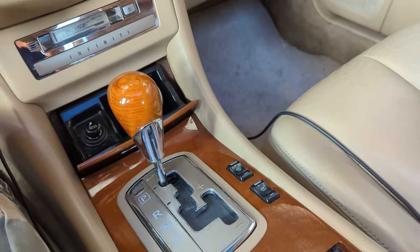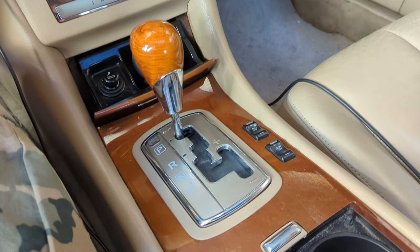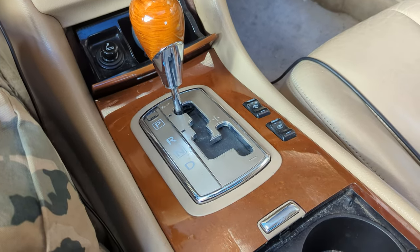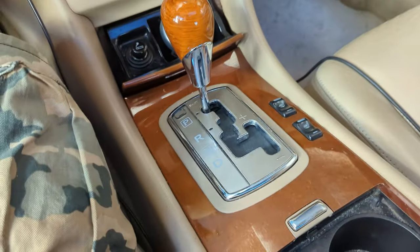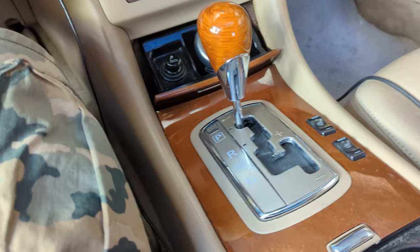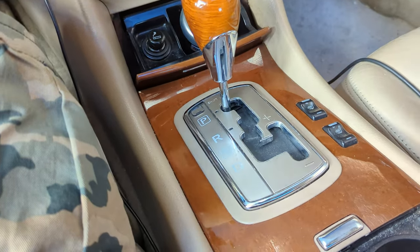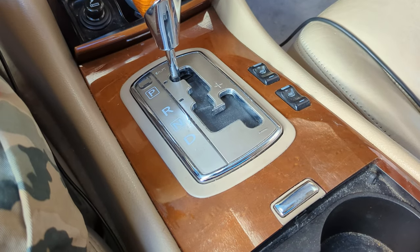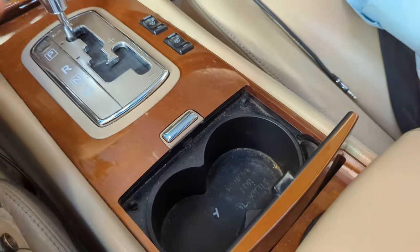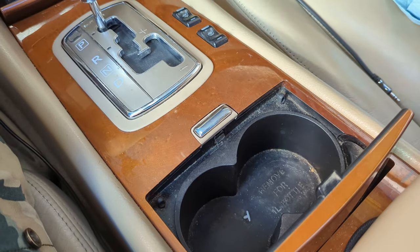One of the other things they do is cut one of the wires from the ECU to the brake lamp, and what that does is allow you to do a standing burnout. Now in this car when I disabled the yaw sensor — at least at the track, maybe on dry ground it would be different — it absolutely rips burnouts at 5,000–6,000 RPM, no problem, and I'm on the brake. So I think they are a little bit different. Anyway, I'm going to cut back to some previously recorded footage and talk over it.